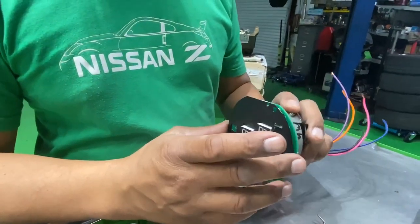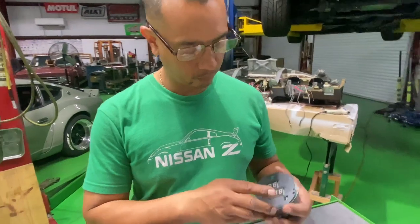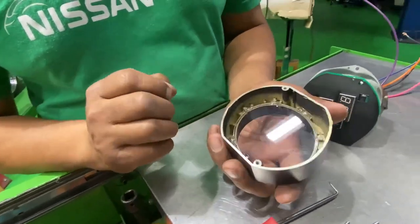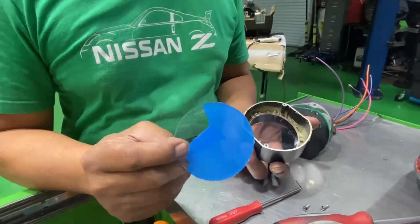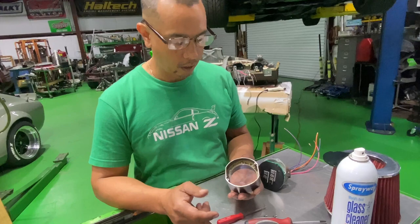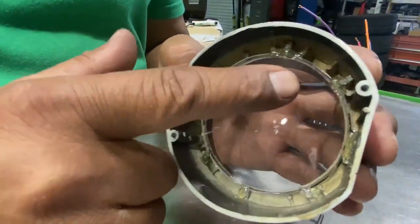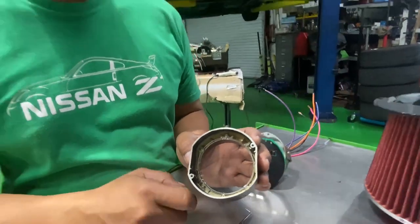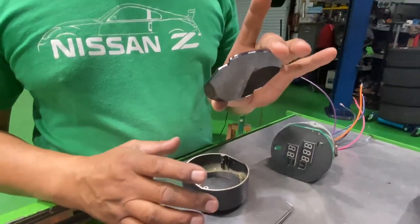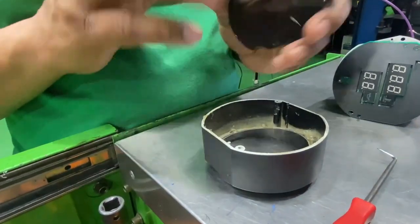With the Intellitronic gauges they come with just the circuit boards, so what you have to do is use the old housings for all the gauges - take them apart and reuse them. We went and refinished and repainted them, and I also cut some new plexiglass to put into them because this is a 45 to 48 year old car. The old plexiglass got a little crusted looking over the years, so we cut new ones and hot glue them back in, assembled with the factory hardware.